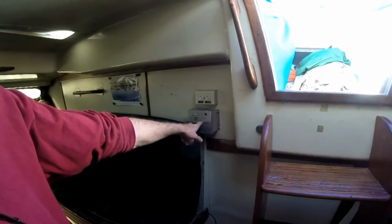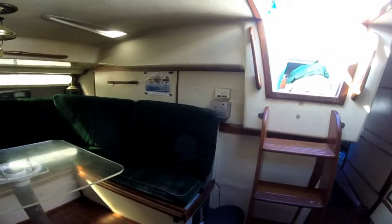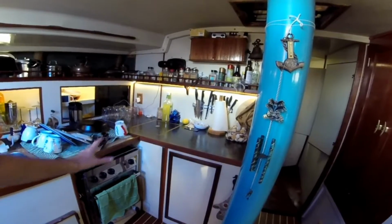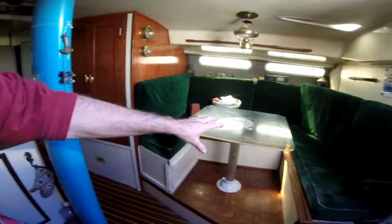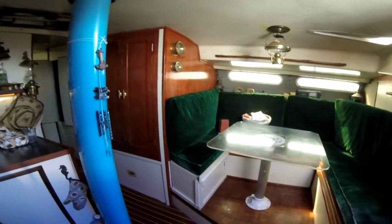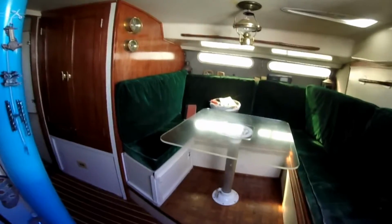The thing I'm really stoked about is having the solar panels hooked up. If anything happens with shore power, somebody bumps our plug, or shore power goes down for some reason, this thing will float on the two solar panels and do just great. The refrigerator, we spent about a day and a half just on solar panels. Refrigerator cycling did great. Even while we were doing that test, I had our laptops set up over here charging, and of course you're running the microwave over here. It's got some trickle power going into it to keep the clock alive. Everything is running off the solar panels, doing just great, including charging the laptops and both our cell phones, one of which was being used as a hotspot. So there's what we're doing so far.